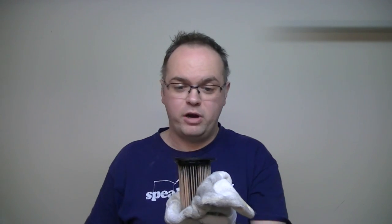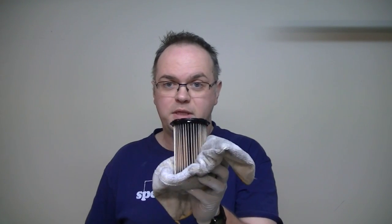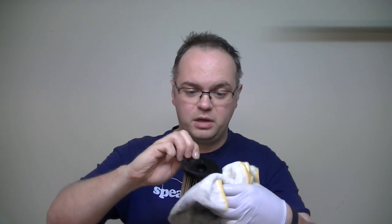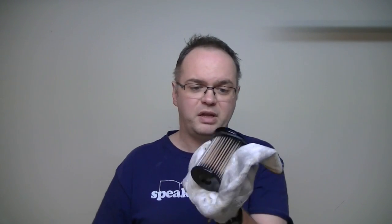Right, so I made a bit of an error when doing this, but I'll tell you all about it, so hopefully you won't make the same mistake as me. So we had the filter, we had the little O-ring, we had the big O-ring, and the mistake I made was I put the large O-ring back on the top of the filter. Well, that's not where it goes, it goes underneath the filter. Now, where it was on the top, the filter housing wasn't actually sealing properly, so when I was priming it, I started noticing little bubbles. Well, that's not good. So I checked my work, and sure enough, I put the gasket in the wrong place. Easy to do. It fits both sides, but yeah, save yourself the trouble.